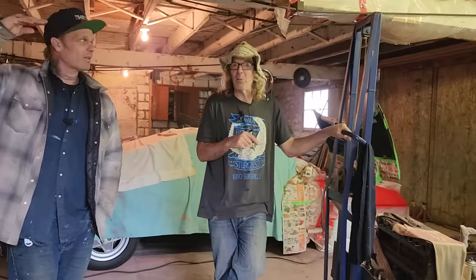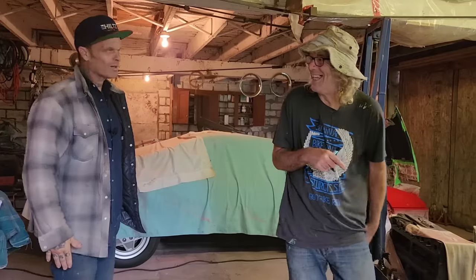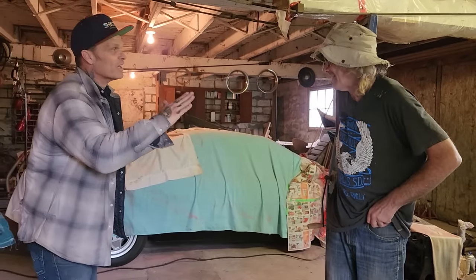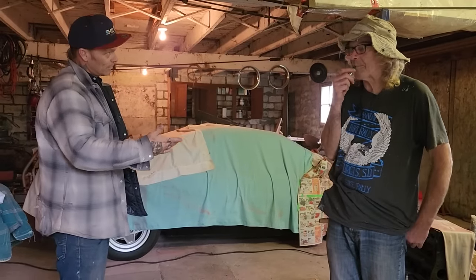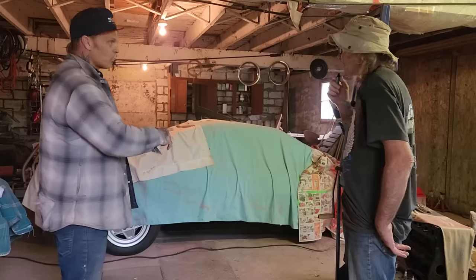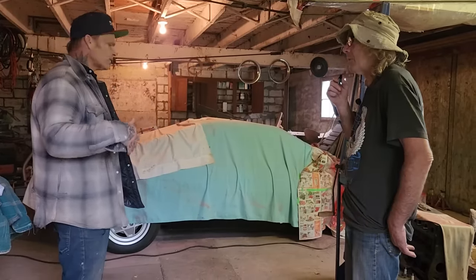Worst comes to worst, I'll wash it off. No, don't wash it off. You'll have a mess. I'd rather see you sand it with a piece of sandpaper than wash it off. You'll have a mess if you start washing it. Don't do that. Just put some paint on it, then sand it. But yeah, if the fish eyes get real bad, I wouldn't wash it off, I'd sand it.